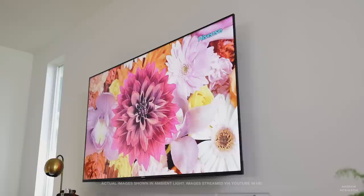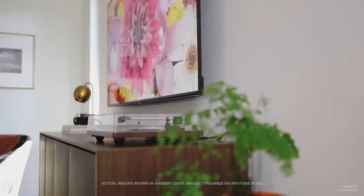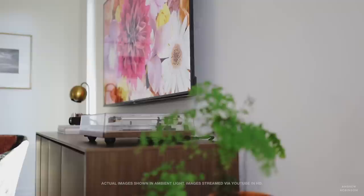Another thing that helps this TV tremendously — but you have to go in and disable it — is all of the active or dynamic backlighting controls. Turn all of those off. You're also going to want to turn all of the motion interpolation stuff completely off; they're terrible. This has some of the worst dynamic backlighting I've ever seen, and I had that same complaint with last year's model. What has improved over last year's model is the light uniformity edge to edge, corner to corner — light uniformity is much improved. As a result, off-axis viewing has gotten just a little bit better.